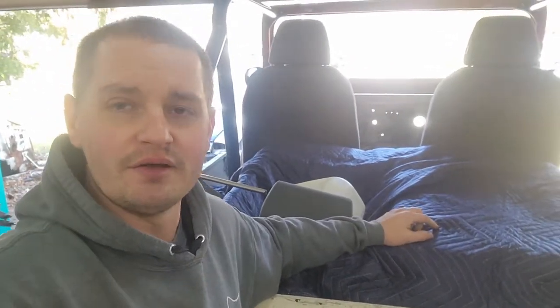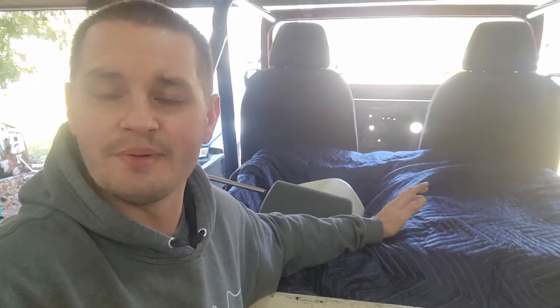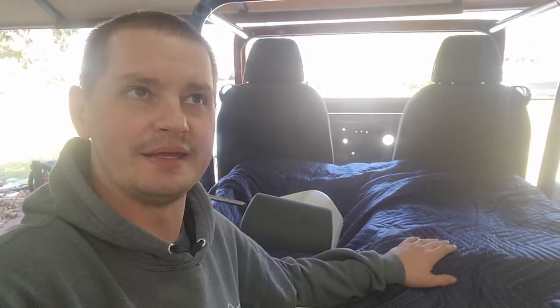The other reason I can tell this is a second gen tub, this has got a balsa wood core, which is not bad. This is how boats have been built for years. If you buy a modern sailboat, it's going to be fiberglass with a balsa core. That's standard building practice and works fantastic as long as you keep the water out of it. The first gen tubs, and I remember this from their video way back when my brother bought his tub in '93.